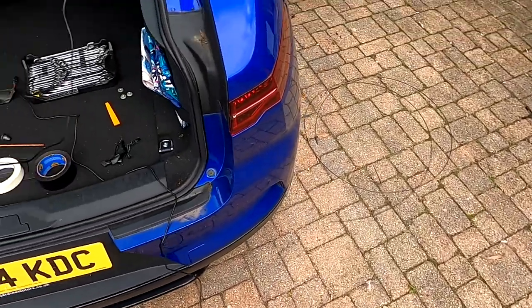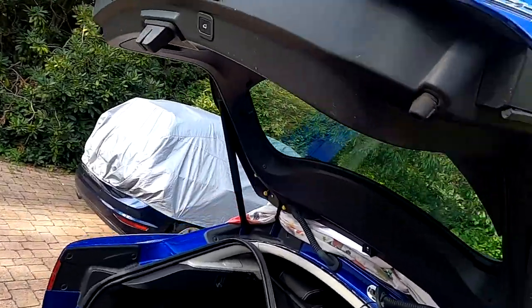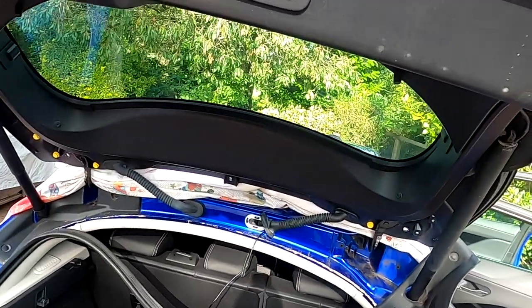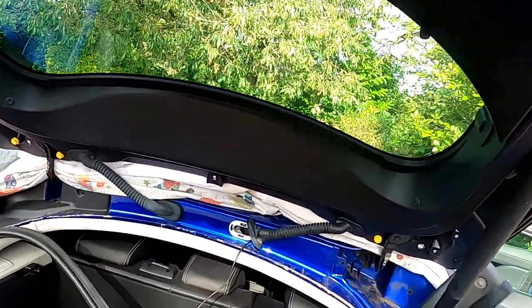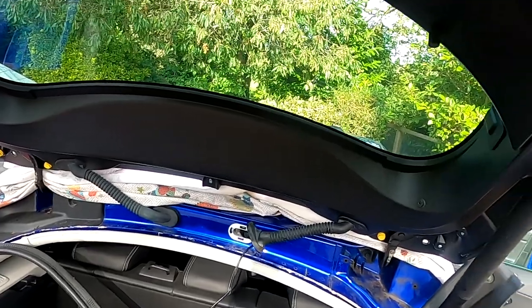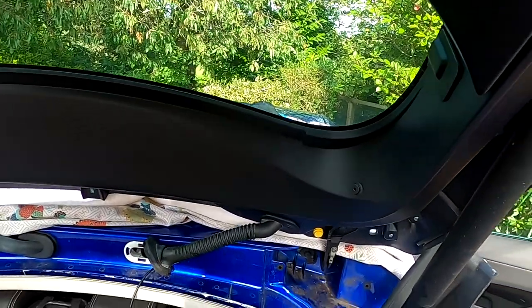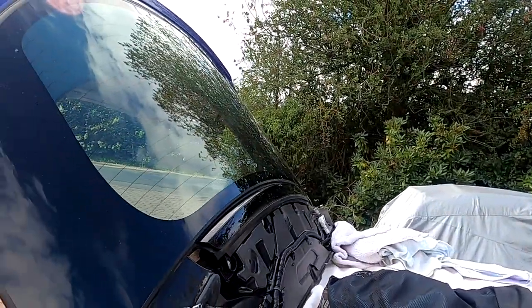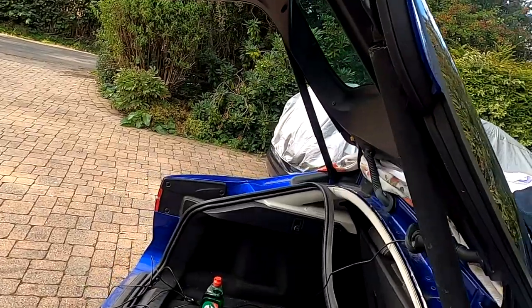Cable through. Almost it. Okay, so it's taken me about an hour to get the cable through that rubber boot, and I've learnt a lot. Could have done it in 5 or 10 minutes if I'd known several important things. The first is you must take off the rubber boot at both ends. Secondly, using fairy liquid to lubricate the rubber and also the cable as it's going through makes it a lot easier. And thirdly, if ever you want to get tape off something, don't use Gorilla tape, because it's a real pain to take off.